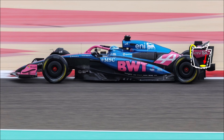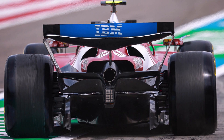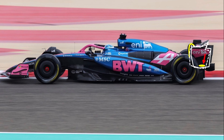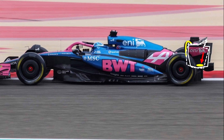Because teams want this effect, they increase it by stiffening up the pillar and using a few layers of carbon less for the beam wing. So these rear wings were backing off more in the past. That is the natural deflection of swan neck wings, and even if you stiffen it up, you cannot avoid it, just change the magnitude.